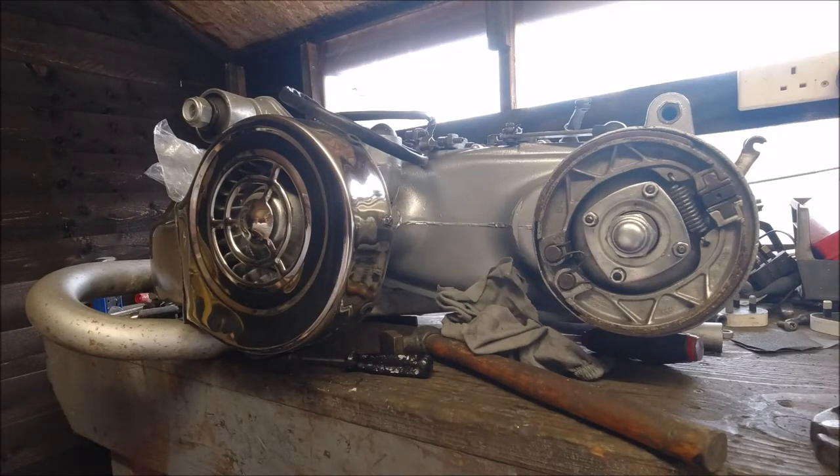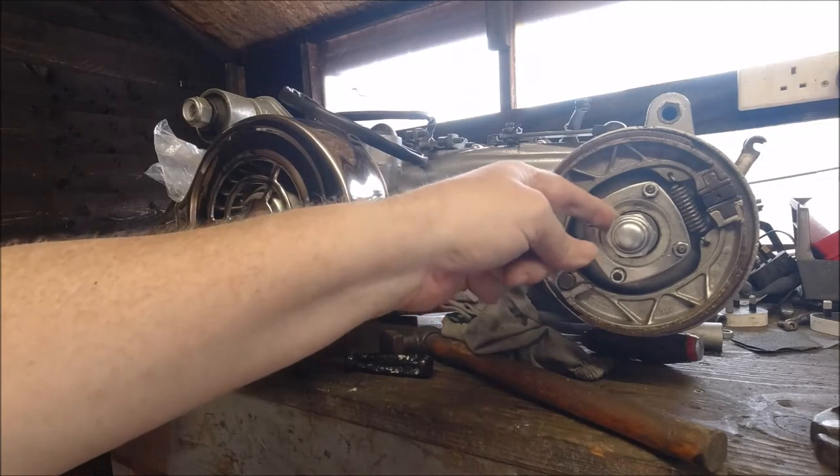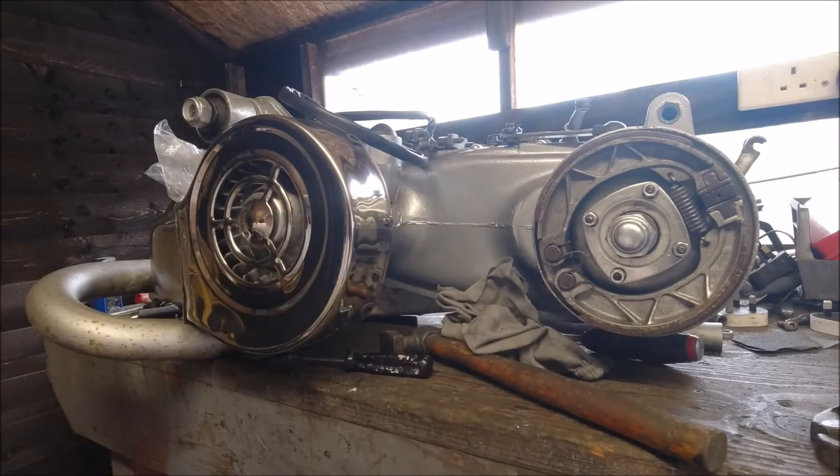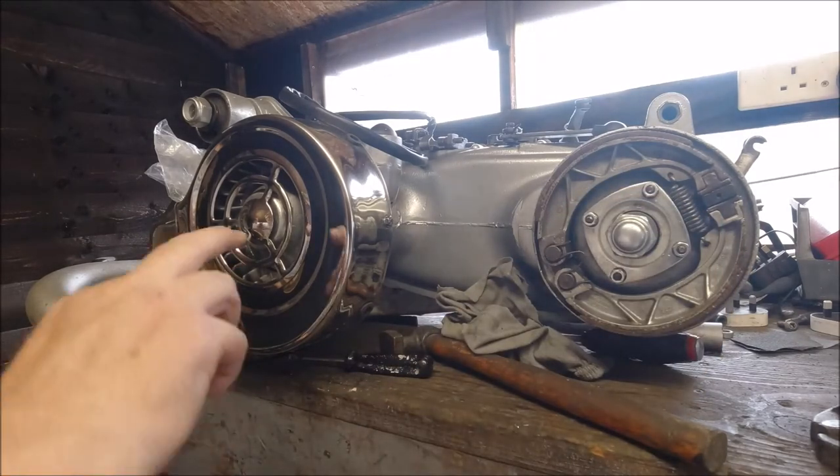The plug will tell you everything about your bike and the condition it's running in. Clutches wear out, especially on tuned bikes — Lambrettas eat clutches if they're standard, but there are cassette clutches available. Now my camera's back working again, I'm going to order a hub for my own bike. In the meantime I'll put the GP hub I've got on this engine, because this engine might end up in my bike anyway.